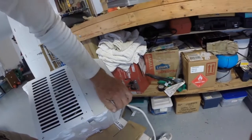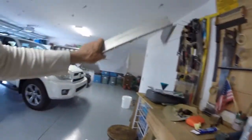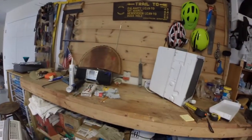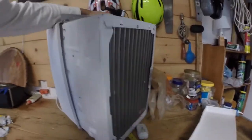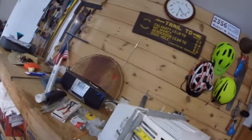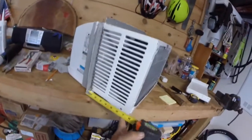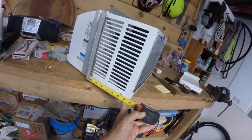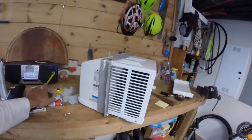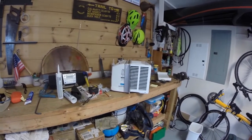Both need to be ground off — I'll take my grinder whiz wheel. This came from my old one, and you want to measure when you take yours off exactly where it is. On the old one, the top dimension is seven and five-eighths on each side, but on the bottom it's closer to seven and five-sixteenths, about the same on the other side. You can see it's not put on quite straight — I don't know if that's by design or was it a Friday or Monday morning.